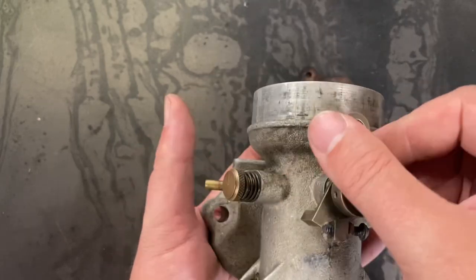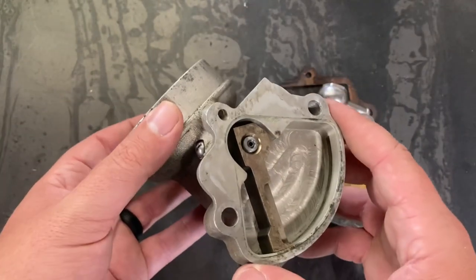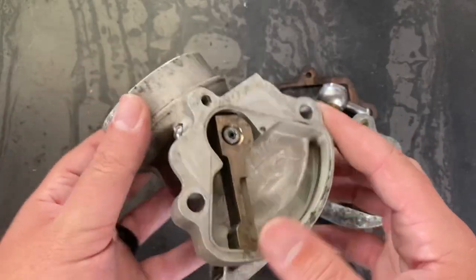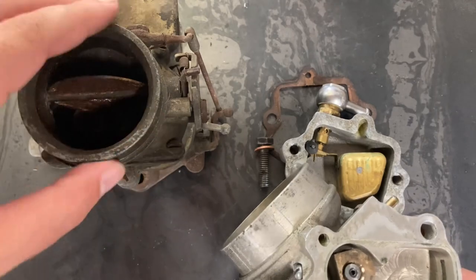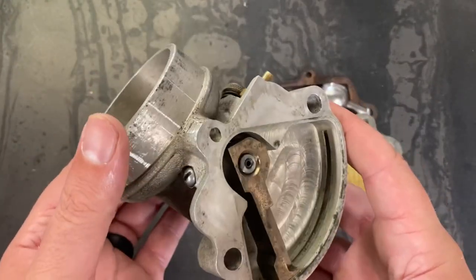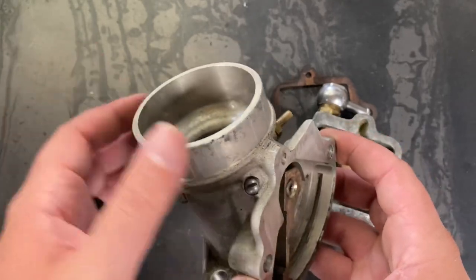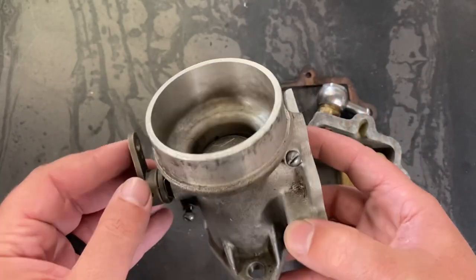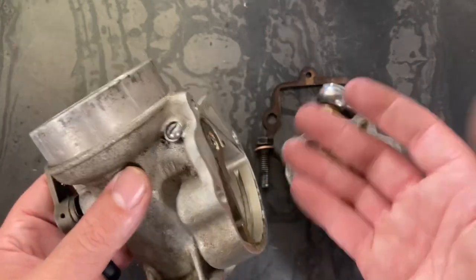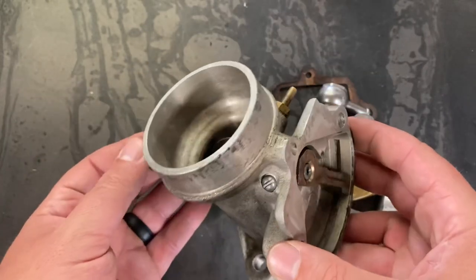There's also your basic throttle stop and a port for your distributor ported vacuum. The overall takeaway is it's a very nicely machined piece of aluminum. That being said, machined aluminum costs a lot more than pot metal with replaceable brass screws, jets, and whatnot. This is much more reliant on machine precision, which makes it a nicer, more precise piece of equipment — but it comes at a cost. Back in 1955 the price was upwards of $49, which in today's money is about $516 for a carburetor.